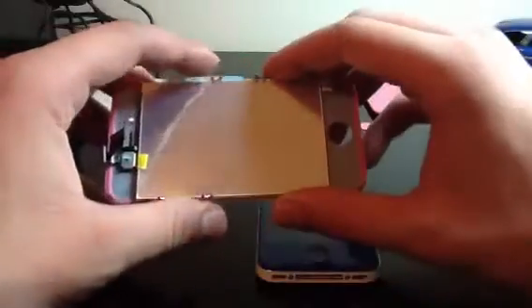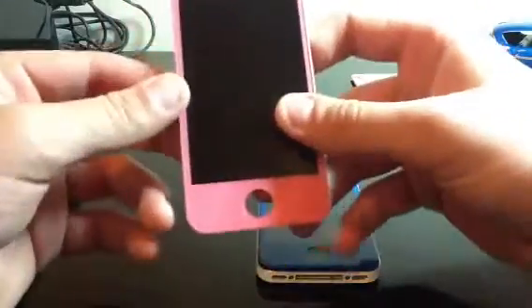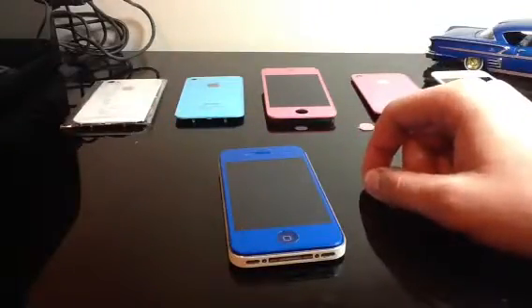I'm going to show you a front assembly of the aftermarket part. Just to be completely clear: all colored parts are aftermarket — there's no such thing as OEM or OEM quality, though it might be the same LCD quality or better. This is how they should ship. You can buy the LCD and digitizers not fused together, but I highly recommend against that, even though it's cheaper. If you want the best possible quality, go with them fused together so that dust doesn't get between your LCD and digitizer. Go on eBay — you can find kits for about $50 to $60 for a 4S, or about $45 for iPhone 4 depending on the seller. I can send you links if you want — just PM me or comment below and I'll personal message you.